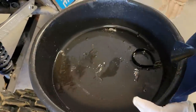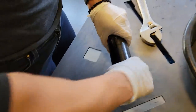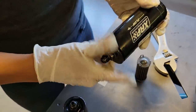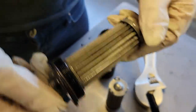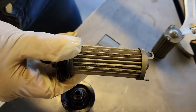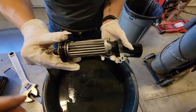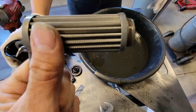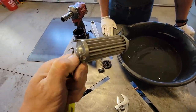So far so good. It doesn't look creamy like it did before. We got to get the other one off and then we'll crack these guys open. Nothing in that one — this one has nothing. There's a little bit of junk in there. This is pump number two, and this is pump number one — our primary one. That looks pretty good; that ran the whole race. That's all the crap from the whole race, so the tank is fairly clean. Clean them off, stick them back together. Pump number two looks good — a little twisted but good.